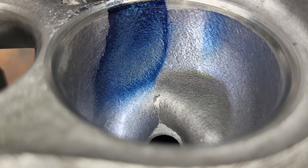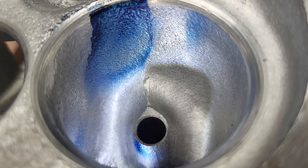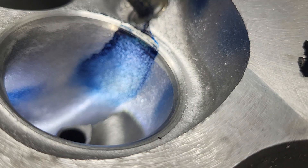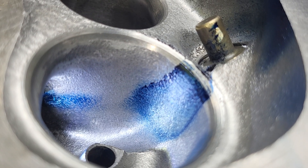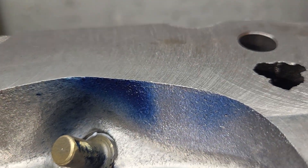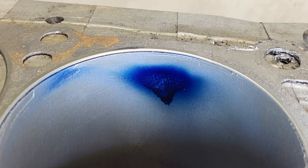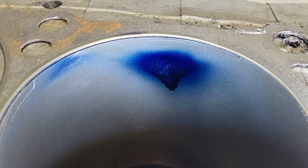So I think we're going to wind up straightening that out. As you can see, the roof of that bowl is not nearly as wide as I would like to have made it. I really have to check casting thickness before I go any further. We do have a little blue on the other side of the guide, and we do have an interesting blue swath going right down the center of the cylinder wall. As far as our chamber and our bore, it looks like both took a step back. I'm not really happy with that at all. So we're going to take that boat tail, straighten it out, and see if we can get back what we need.